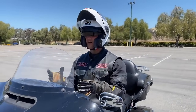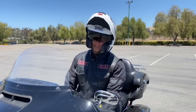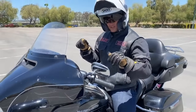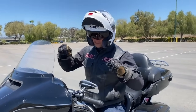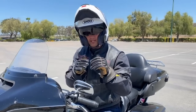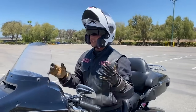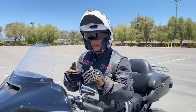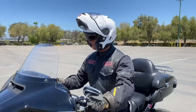So as you go to take off, just like you're taking off on any other bike, this bike has a whole lot of power because it's a big old whatever it is, right? So probably with the clutch alone, I could just ease out the clutch slowly. Now this is where a lot of people drop their heavy bikes. Once you begin to move, a lot of people just let go of the clutch and it stalls and the bike falls over. So the challenge is, once you start to move, you ease out the clutch a little bit until it starts to get power, then you hold it there. For how long? Until about 5 miles per hour. Let me show you what I'm talking about.